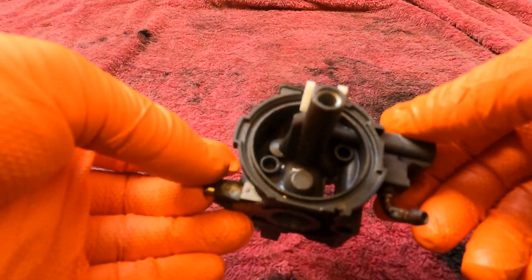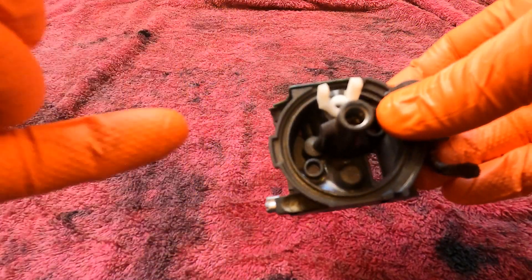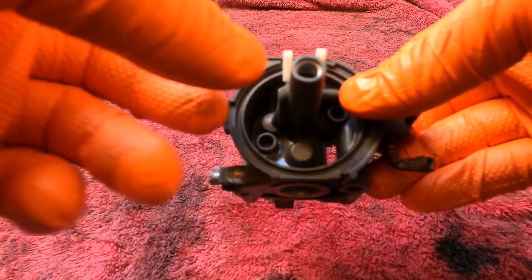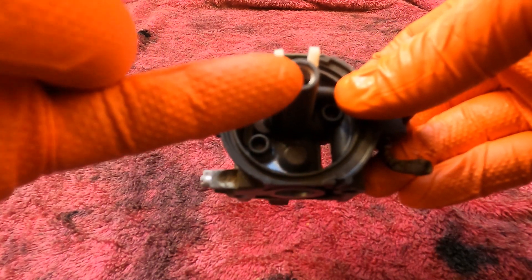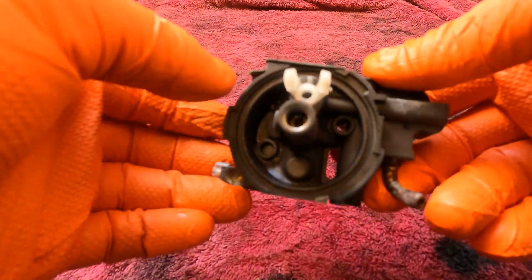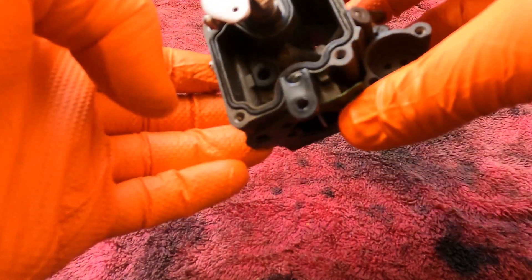I've had a good look at it and given it a good clean off camera — just got these gaskets left to remove. It's not as bad — surface contamination comes straight off. The only problem is I can't get the jet or the emulsion tube out. I've tried but the inside is quite corroded, and when I get the screwdriver in it's just taking the top of the jet off, so I don't want to do it any further because I'll end up wrecking it. I'll give it the best clean I can. I've blown it all through with compressed air and cleaned it with carb cleaner.